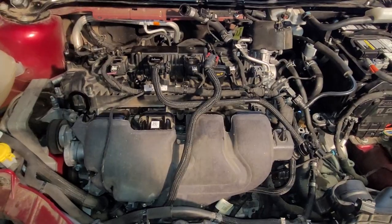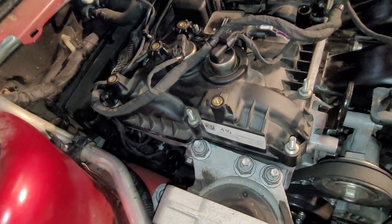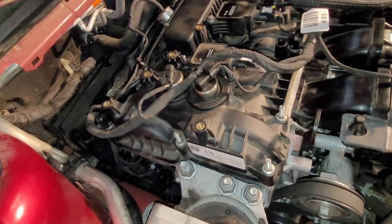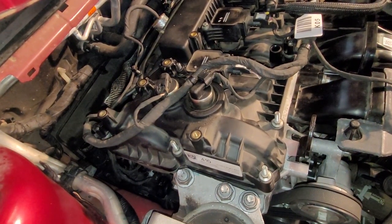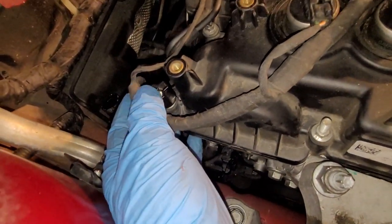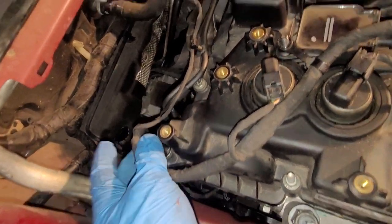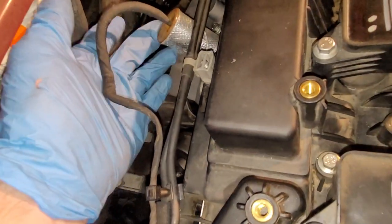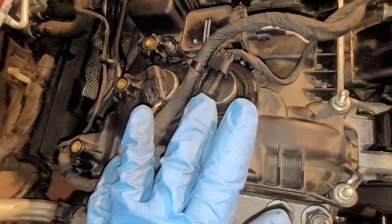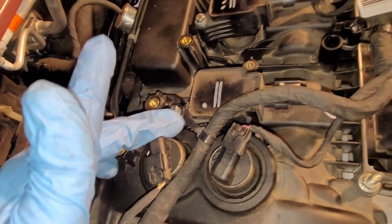Okay, I've done as much as I possibly can without getting the air intake on. So, starting over here. You know, the way that they design wiring harnesses these days, it's really hard to mess this up. You just kind of lay things back how they go. They only put enough wire length really to fit what it needs to go to. So these threaded studs here on the valve cover, place the harness on here. You can run this wire over here to the sensor for the turbo back here. Wire up your VVT actuators. There's a threaded stud for this coil pack. Just put that across there.